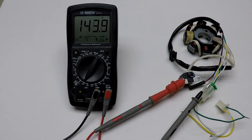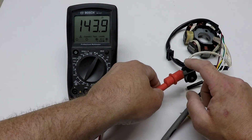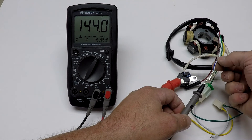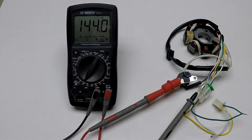Here's a bonus test: the pickup coil — sometimes it goes bad. To test your pickup coil, put one lead on the ground and one lead on the blue and white wire. Put your multimeter at 200 ohm, and you should have a reading around 144 ohm if the pickup coil is good. If you don't, your pickup coil is bad.